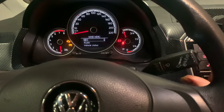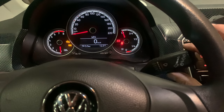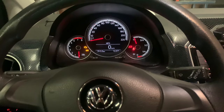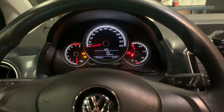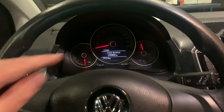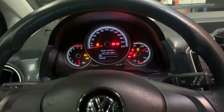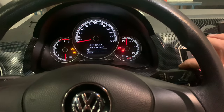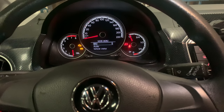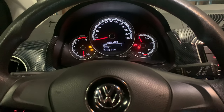The trick is to find the OK button, which is under the wiper handle — this button over here. Once you've found that, the service indicator for this car is reset. To summarize: turn off the ignition, press the button, turn the ignition back on, then press OK with the button under the right thumbstick on the steering wheel.